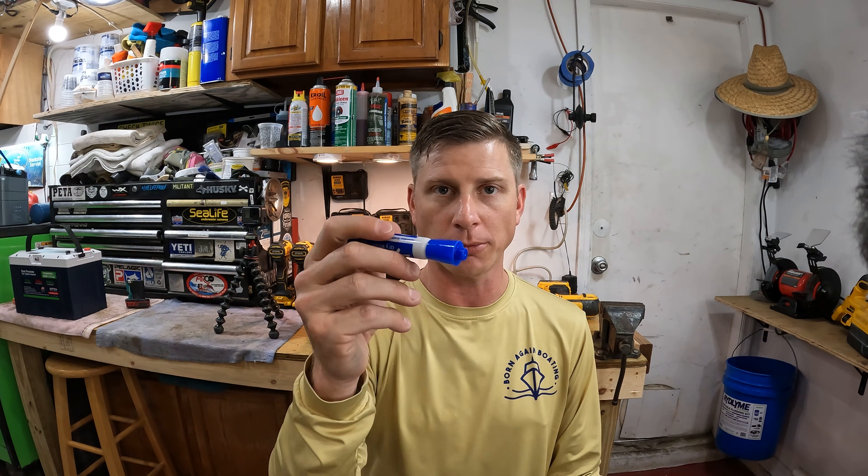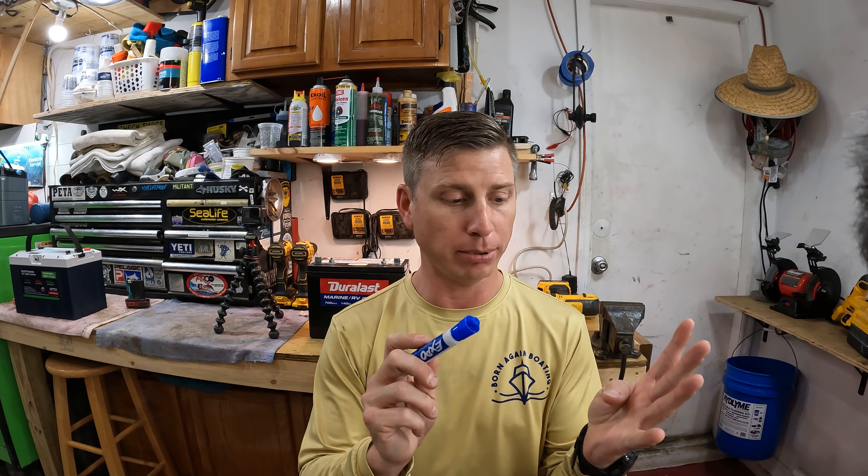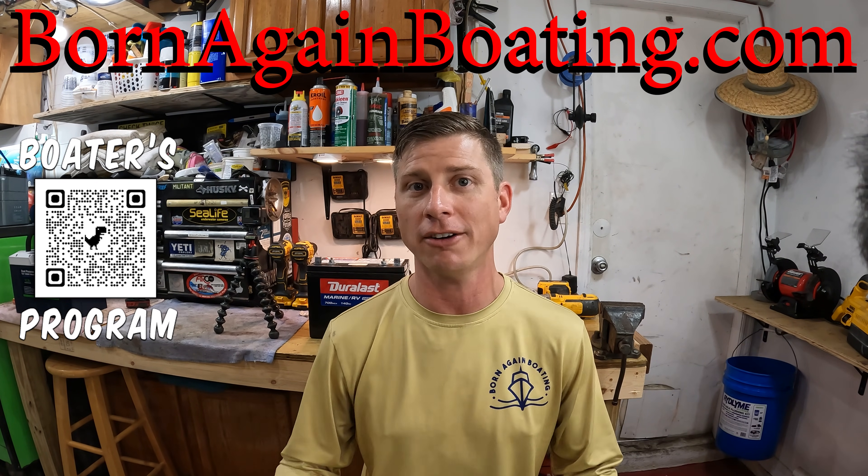It's not uncommon to have a problem with any one of these sensors, but now you understand how they interact with each other. That transfer pump a lot of times will lock up. There is also a filter on there, so if that filter gets clogged, the transfer pump might turn on but won't be able to push any oil through to get to the engine. The sensor on the engine oil tank will let you know whether you're getting oil. It's also important to note that the harness from the engine to the oil tank — probably 50% of the time — goes bad, whether that be a bad ground, a bad black-red wire, a bad blue wire, or a bad brown wire. But at least now you know what each one of those wires does, so you should be able to understand the system and diagnose your problem if you have an issue with the Yamaha precision blend system for their two-stroke engines.